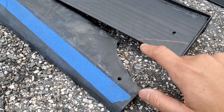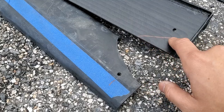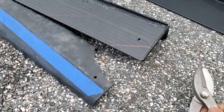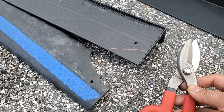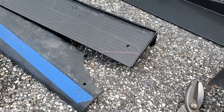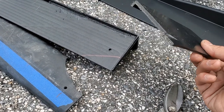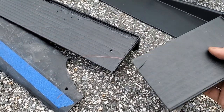The test fit was good, so I'm going to go ahead and cut this piece out here. You can see I've marked it already with a sharpie, and I'm just going to use a pair of tin snips to do it. If you're not certain if your tin snips are going to work and you've trimmed off the front piece of yours, you can just use it as a test piece to see how well your tool is going to work — and this was able to cut through here without any problems.